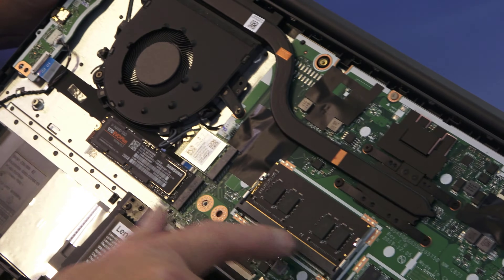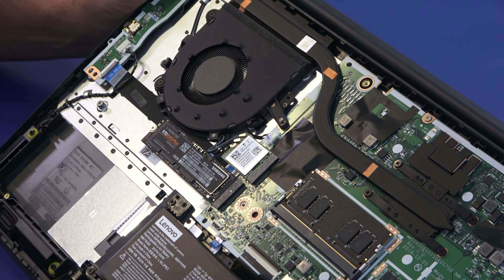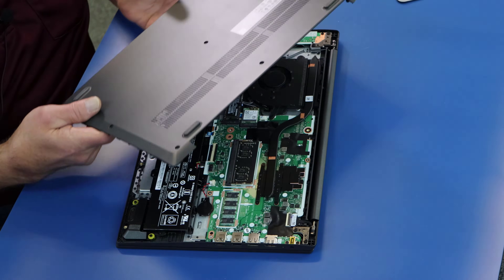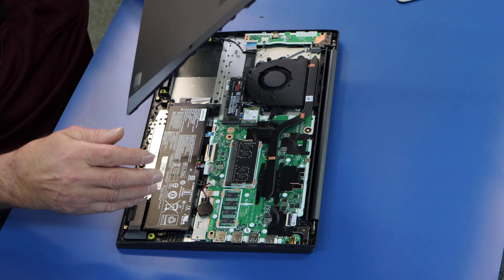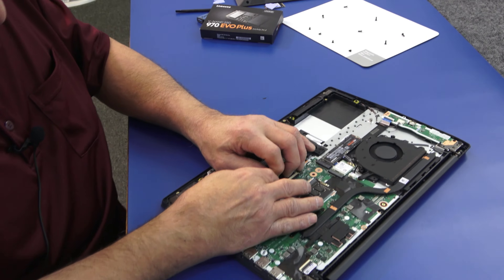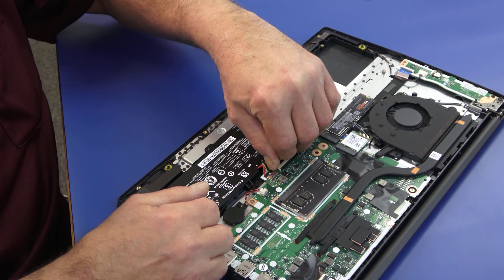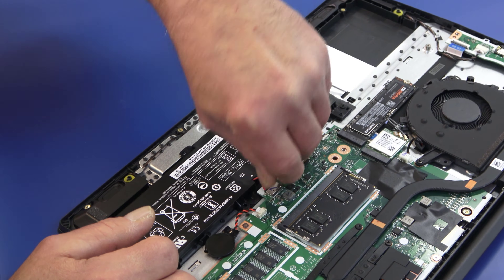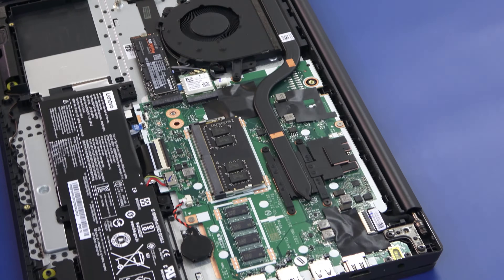So that was pretty quick — we got our extra 4 gigs of RAM, we got our new 250-gig SSD. Our wires are still okay there. Got our battery. So we can put the bottom back on. There's pretty good ventilation along the bottom here where our heat pipe and cooling fan is. So we're going to put the battery connector back in. You've got to be patient — just tuck it down there. Once you plug this in, be careful — don't be touching anything in there with your metal tools. Just make sure it goes in all the way, which it did.